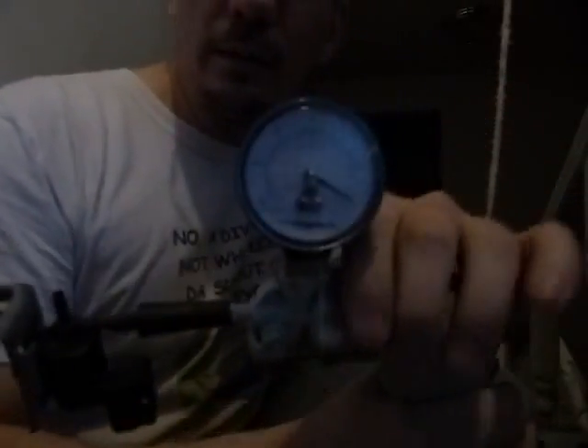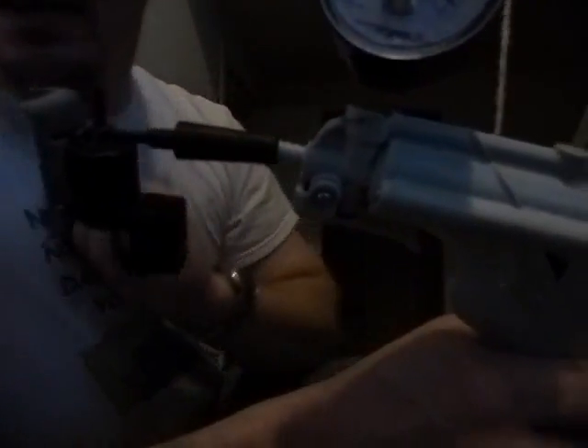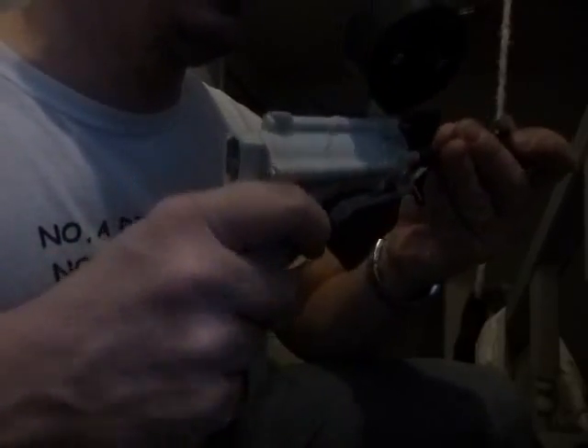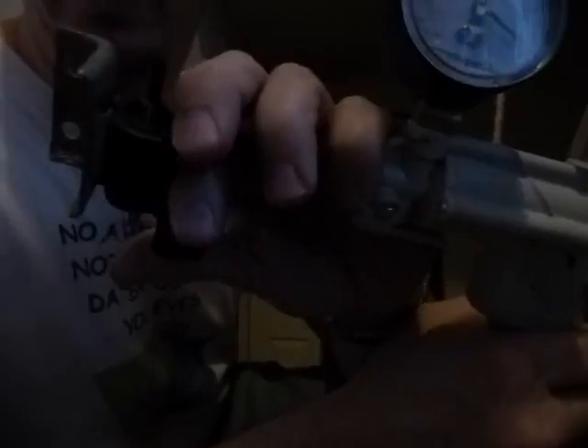Let me check it between ports B and C. I'm pumping and the needle is moving, but there is no vacuum — the air is flowing through as it should. If I seal this hole with my thumb — wait, it fell apart, just give me a sec. Okay, I'm gonna pump to make vacuum and seal the hole. Now there is vacuum, which is released with my thumb. Ports B and C check out.